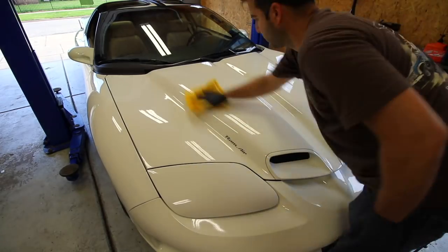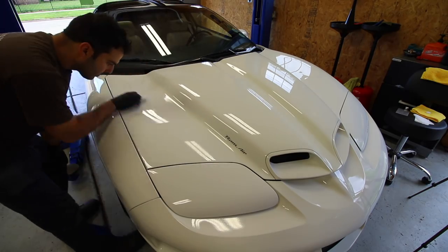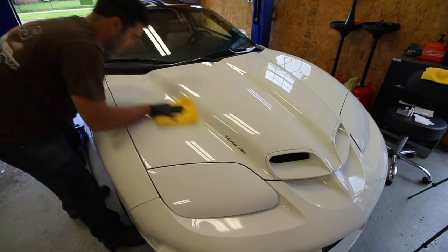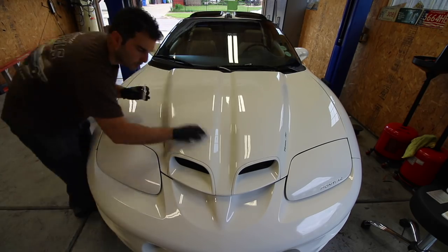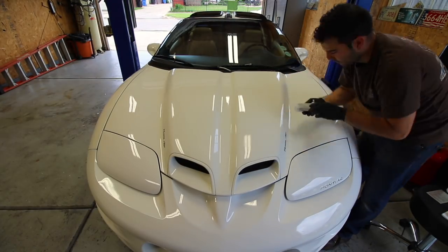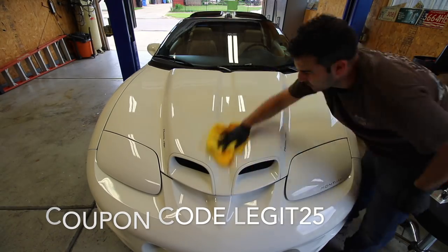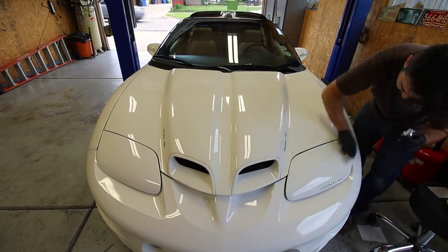The application is similar to waxing your car, but a ton easier. Just like when you apply wax, you want the paint to be clean. If you have heavy scratches, buff and polish first, but after that — or if the paint is in good shape — just wipe with rubbing alcohol and apply the ceramic coating. Just a few drops on the provided cloth and applicator pad and wipe it on. It's self-leveling, takes a few seconds per section, has a 9H scratch resistant rating — the highest a ceramic coating can get. Use my link and coupon code in the description to get $25 off, making an entire kit only $45.